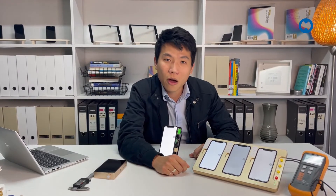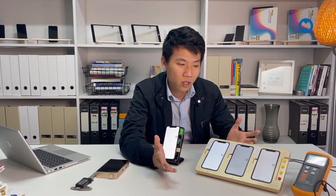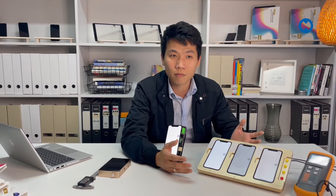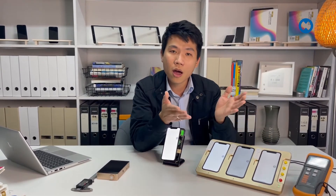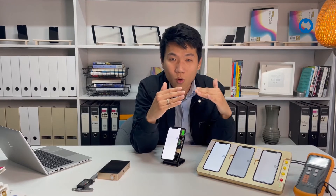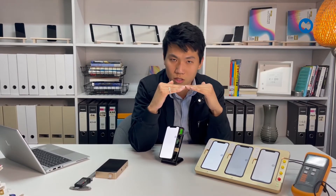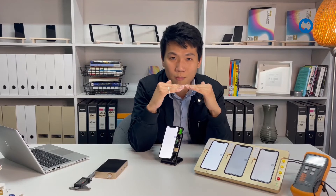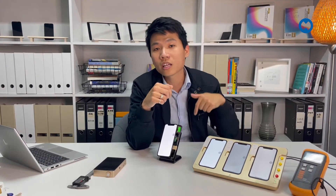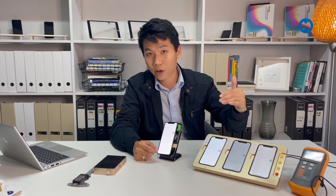Many customers who want to offer premium quality don't want to use LCD with different color palette or lower quality — they want something close to original. That's where OLED comes in. With hard OLED, it's made by two layers — OLED at the bottom and glass on top — but the OLED panel is very rigid, like cement. Even small impacts, like pressing a screen protector too hard or having a car key in your pocket, can damage the OLED and cause the display to go black.